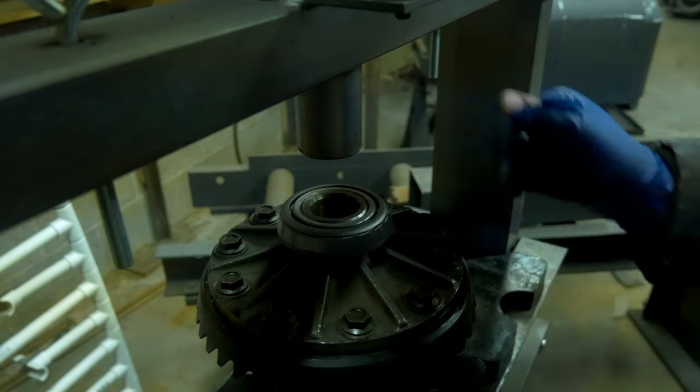The next day I come out after this RTV has completely dried, take a hand ratchet, and snug everything up, which does lock down that lock washer. And then we're going to break out the trusty old torque wrench. And yes, I use a torque wrench on everything. It's a habit. It's a good one to get in.